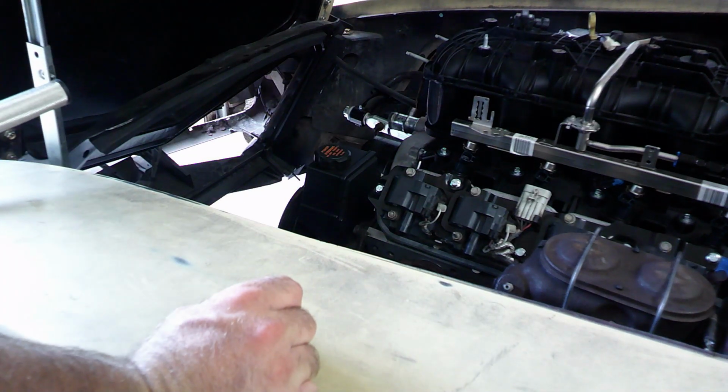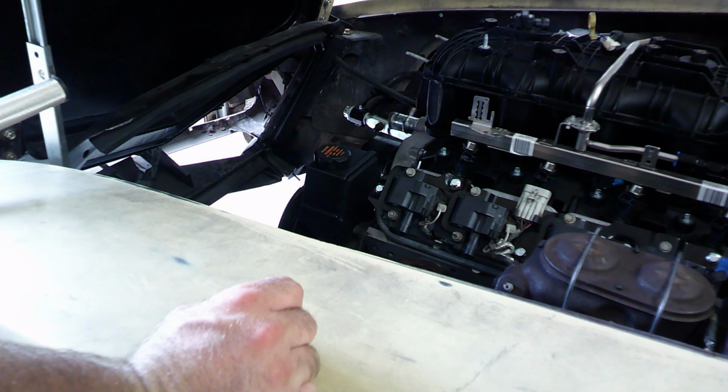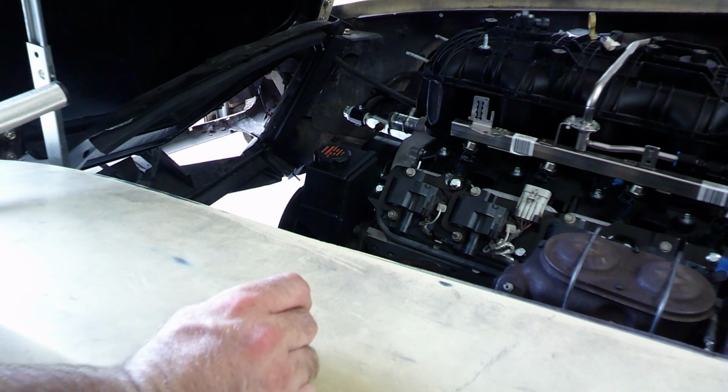All right, water pump is on for good. It is torqued, and I'm gonna go ahead and do a little cleanup here afterwards. I'm gonna go in and eat real quick, and then we'll wrap this thing up for the night. All right, guys, the belt is on. Goes around the power steering, down around the alternator, up around the idler there, and down around the crank. So it is good to go. It's a small victory here. So got the water pump installed, got to order a couple of parts, but we're ready to go.